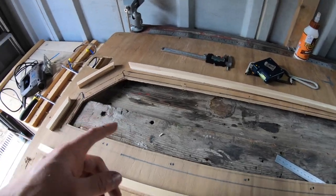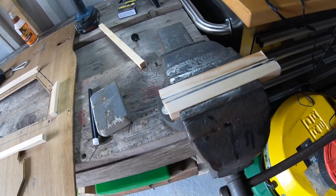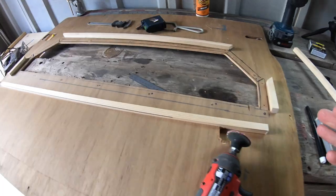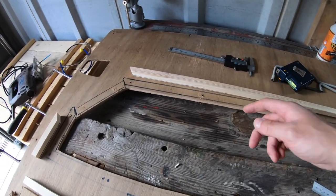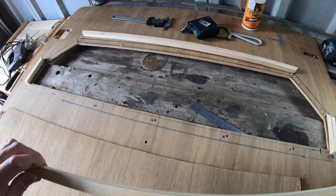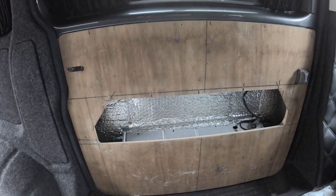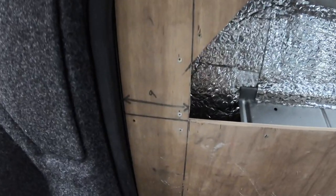What you can do to make all this completely uniform is get the two opposite sides, put them in the vise like that, and then you can go over the edges. Make this as symmetrical and as square as you physically can. We can run around the inner edge when it's done anyway, just to flat it all off. Try and make the nicest job. Use some wood glue — I'm going to wood glue all of these down to the ply board itself. And then when that's gone off, I'm going to leave some weights on it. So this is what it's starting to look like now. We've glued all the battens on the back and we've screwed them in as you can see.